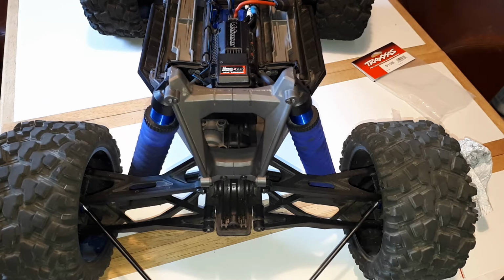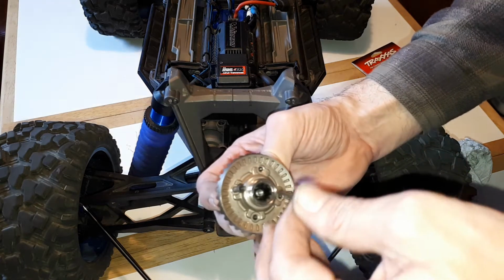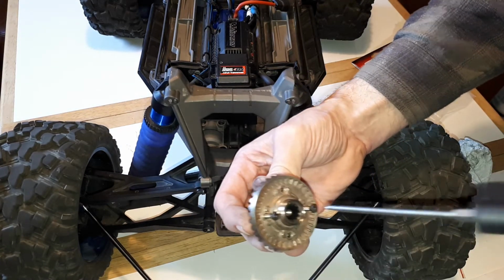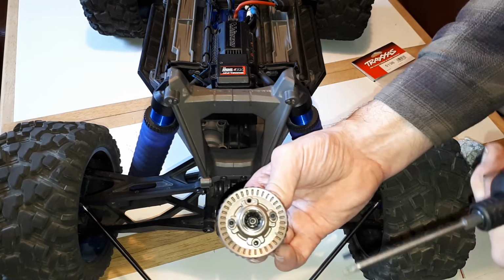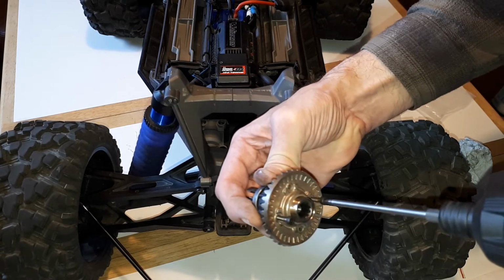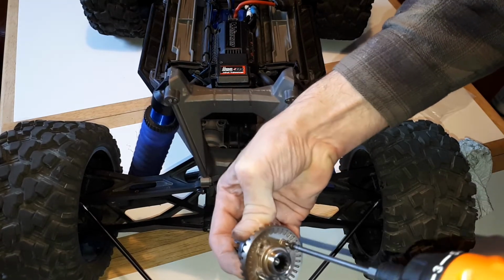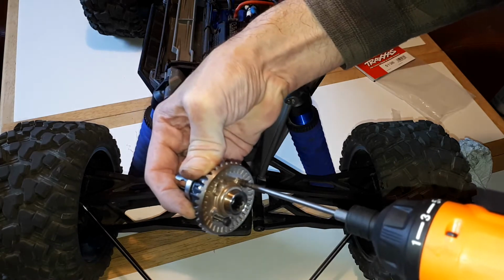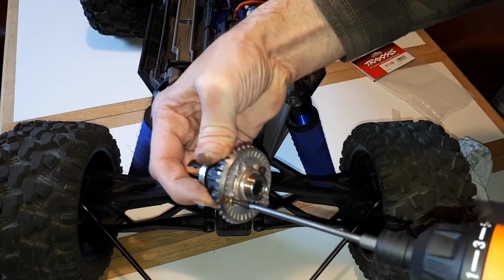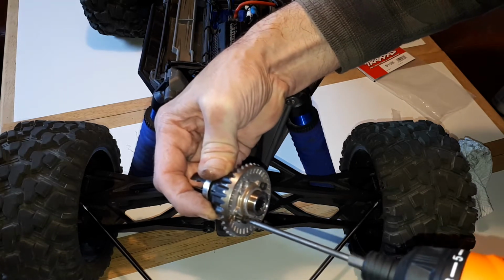And now we put the differential screws back in. Yes. So we get those done. There we go. Like I said, I'll use an electric screwdriver, but make sure I put it on torque setting 1. I mean, it's on the very lowest, so we'll see how it goes first. Yeah, and there we go. You can see how it's going in fine. There you go. Just caught then, but I didn't want it to go in quite as far as that.